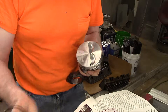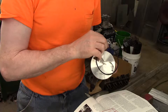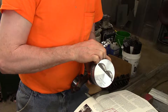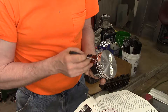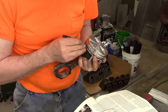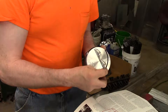I did check crankshaft end play, and it called out for about two thousandths end play. I had actually a little less than two thousandths, which is better to have a little less than too much. I also checked the piston to cylinder wall clearance. My friend Terry had done all the machining, and he did a wonderful job. There was about two thousandths clearance, which calls for about three thousandths, so it's a little tight — that will last a little longer. I was happy with that.